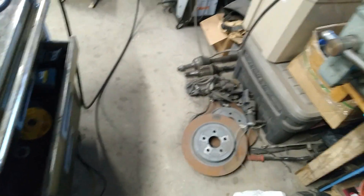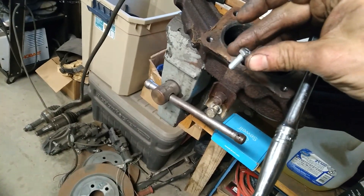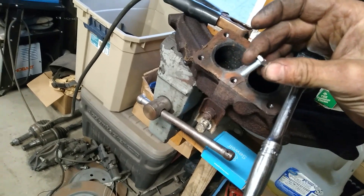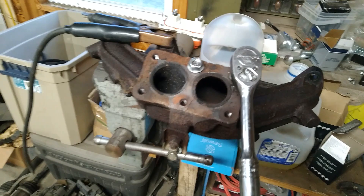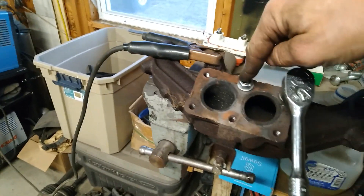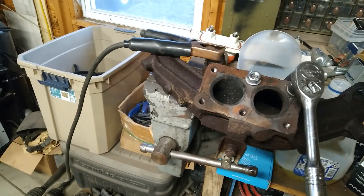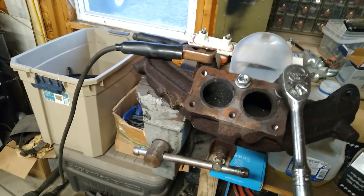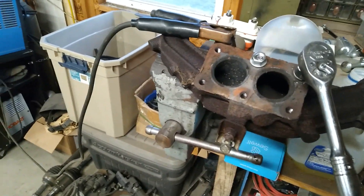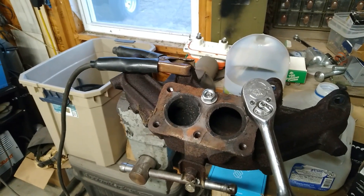Another way you can do it if you don't have this much stud showing through is you can take another bolt and just weld it to the top of the stud. I tried that first with these, but these little quarter-inch bolts just weren't enough — they didn't have enough strength to pull these studs out. They're stuck in there pretty good. Also, I had these sitting with PB Blast — just any kind of penetrant spray that you put on there to break the rust. Had that sitting there for several hours and you can see they're shiny and oily inside there. That stuff got in there and loosened those threads up a little bit, but you do need a little bit of help.